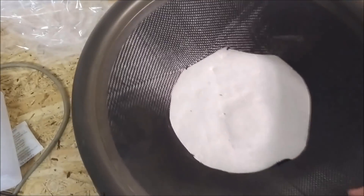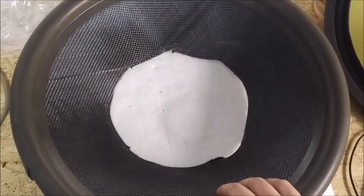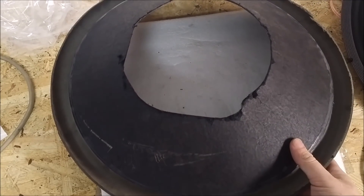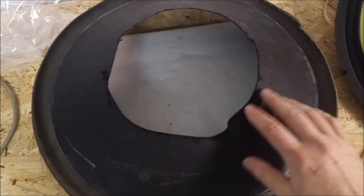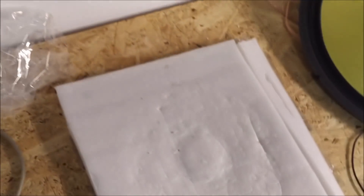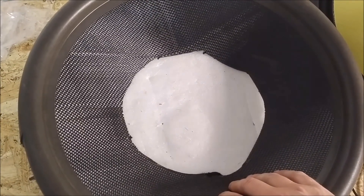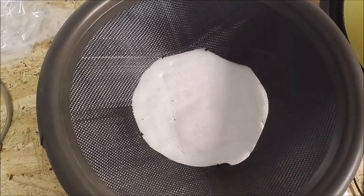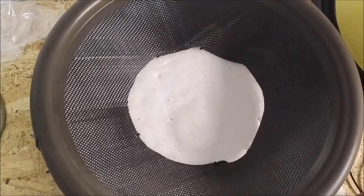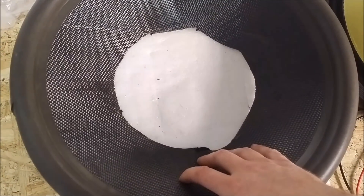Then you have this cone, which is very arguable. It looks like carbon fiber — I call it 'carbon-phober,' because it's not carbon fiber. Also, on the back it's paper, so it's not pure in what it is. The inside of this is cut out, which does affect strength, but it is rather flimsy. Of the companies that use this on the same exact sub — there are probably four or five companies — they all say this is Kevlar, or a Kevlar laminate. But it's not Kevlar either.